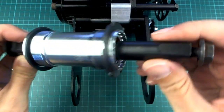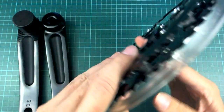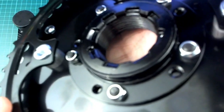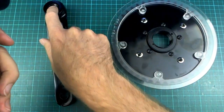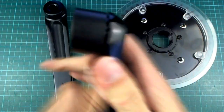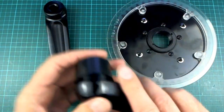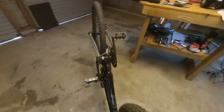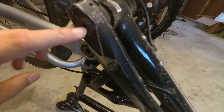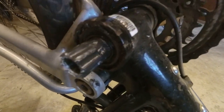The other thing I'm going to try attaching today is this chain ring. There's quite a fine thread on the inside of it, and that goes to one of these pedal cranks. The cranks are different - one has nothing much on the side, and one has a nice fine thread which matches the inside of the chain ring. I gave it a quick test before and it goes in quite nicely. First thing to do is remove the current crank - it's one of those spline types, not a square one.